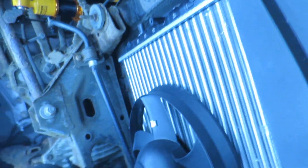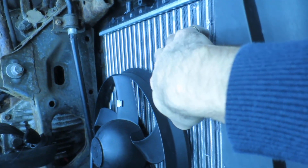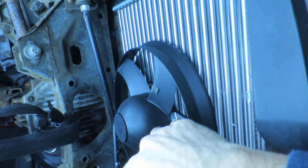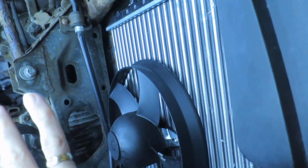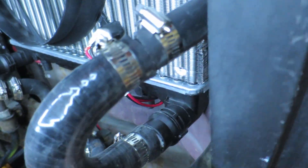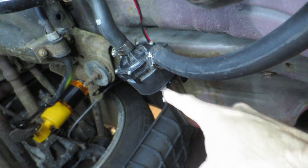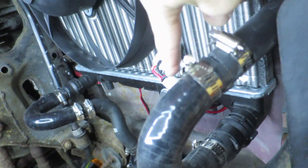Under the car it's quite cool — I've mounted a radiator here. This is from a Volkswagen Polo; it's actually a new one and it came with a fan as well, so radiator and fan mounted underneath where the exhausts used to be, right underneath the car. You can see the pipework going into it. Mounted to that is the original Nissan Leaf water pump on its original bracket from the Leaf, which I've welded to the chassis of the car, so all that's fixed in place.